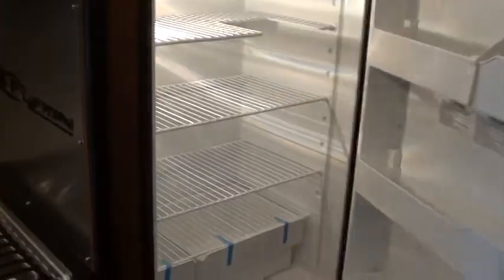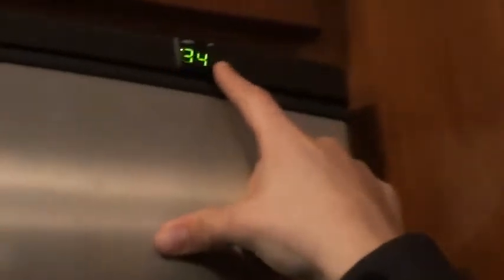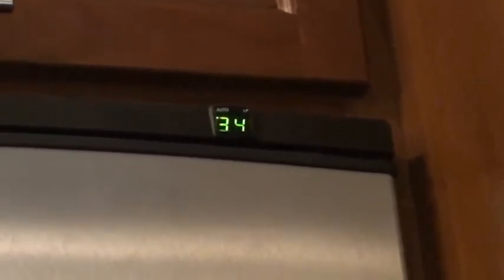Moving over to your fridge — it's a self-temp set fridge. On and off is up here in your freezer area. There's an auto and an LP side. Right now the dot is next to the auto side, meaning it's in auto mode — it'll first try to run off electricity, and if it can't find electricity, it'll use gas from your LP tanks. That's the way we suggest you run it. If you want to use just gas, you can flip the switch to LP.